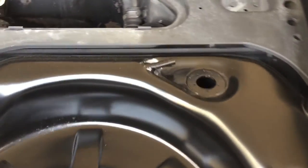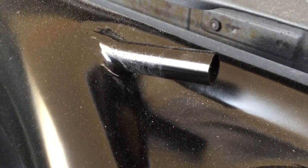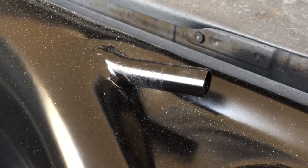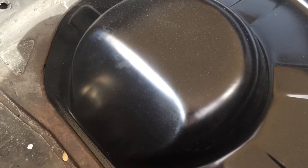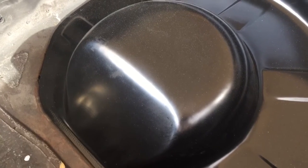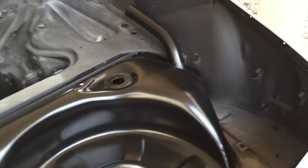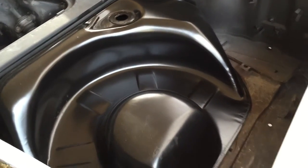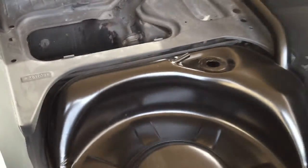The difference between this gas tank and my original is the vent tube — it's a little bigger, about a half inch, whereas on my original it's about a quarter inch. And this bubble part sticking up: my original tank was a complete round, whereas this one has a chamfered front edge. I just didn't want to take any chances trying to restore that old tank — it was too far gone. The seam had rusted out from sitting for so many years with gas in it. But this is a real simple fit — you've got one clamp-down screw and a sealant underneath it.